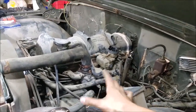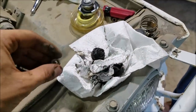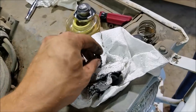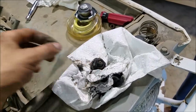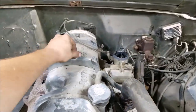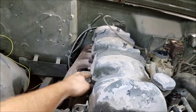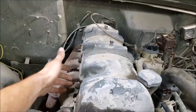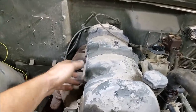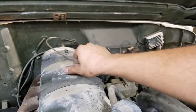The oil was pretty clean overall. It has a magnetic drain plug and it looks pretty good — no rust or any weird stuff on it. The valve cover here is a center bolt style, and we do have another valve cover gasket for it. This one's all petrified, and with the design, it's probably a good idea we change that because if we started it, it would just pour oil. So I'm going to work through this and get the valve cover pulled off.